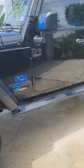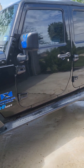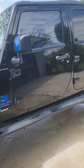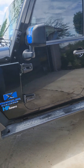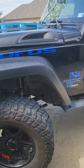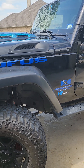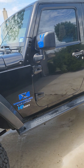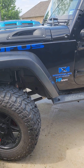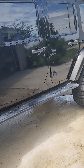What they did was come up with a fix — you get a fuel pump module out of a GM. So I'm using the Jeep fuel pump lift pump, and obviously the LT motor I have in here has a high-pressure fuel pump on the intake and that thing's loud — that's why they put all that insulation. Long story short, they had me hook this thing up with a hot wire, a keyed wire, and a couple of wires to the transmission harness. I drove it, and instead of the monitors making, I got an engine light.